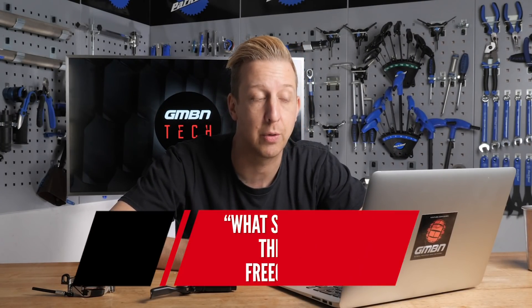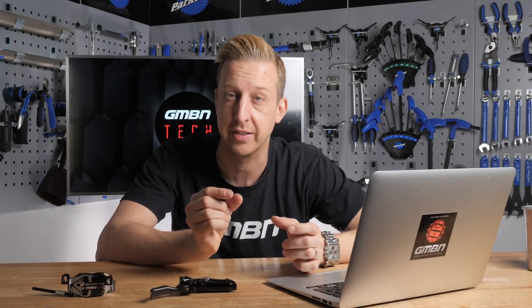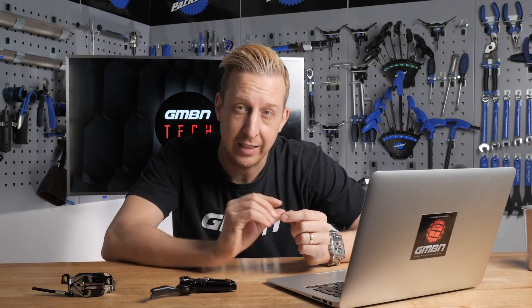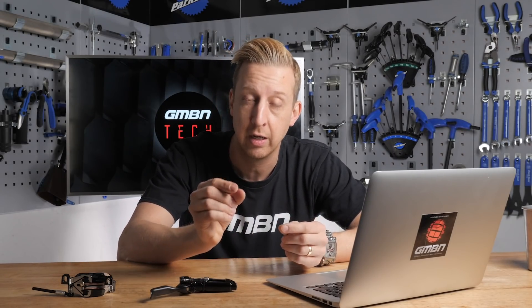Next up is from Koo Yang: "What size spacers do I need for the cassette in order to do the free coaster conversion?" Essentially, what you're doing is taking up the space that the sprockets take. Depending on what style cassette you've got - 7, 8, 9, 10, or 11-speed - they're going to be slightly different thicknesses. Generally, the spacers between sprockets on cassettes are between one and two millimeters, and on 10 and 11-speed sets they're two millimeter spacers, so you'll need a few of those.